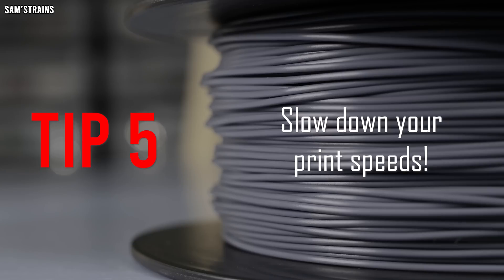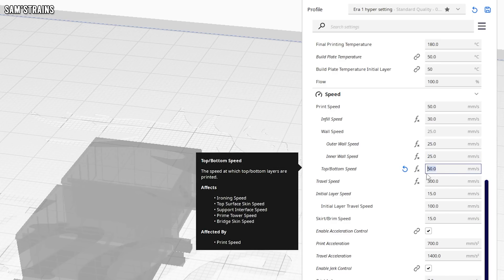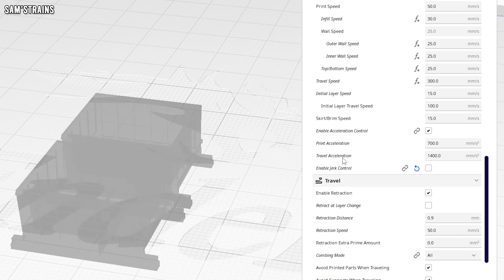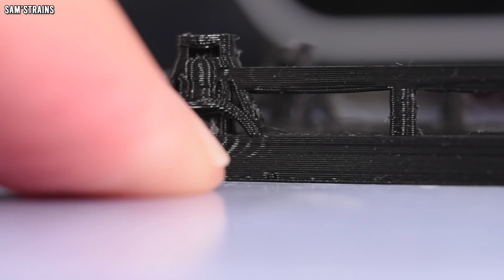Print speed. Manufacturers of 3D printers don't know what you're going to do with that machine — whether you're going to create massive vases or tiny little models — and therefore their preset default slicer settings may not be optimised for tiny little models. By setting the print speed to something small like 20 to 25 millimetres per second you can make your printer really slow down and take its time, which makes a massive difference in print quality. Also, always enable acceleration and jerk controls — I set the acceleration to 700 and the jerk to 7. This stops your extruder and moving print bed from making any sudden moves or accelerations, which can create imperfections or ghosting on your models.